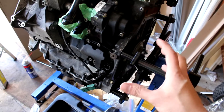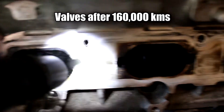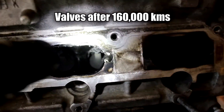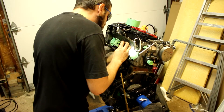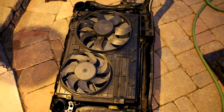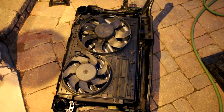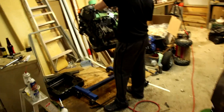The oil pan has to go on, then the rear main seal, then the clutch will be ready to go in, and then we can put the transmission on and try to bring the whole unit into the car. Julian is cleaning the intake valves and we're going to get a lot more flow out of that. I just finished spraying the radiator, intercooler, and condenser with a hose to clear out some of the fins without getting water inside them — this should add a lot more cooling.